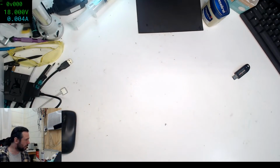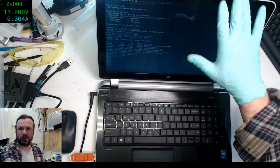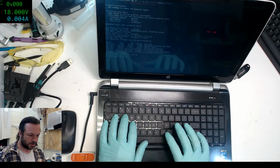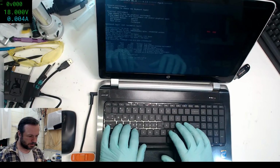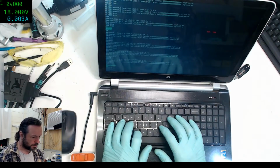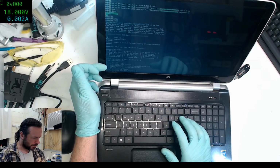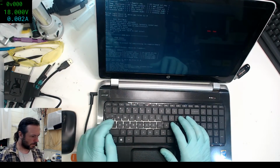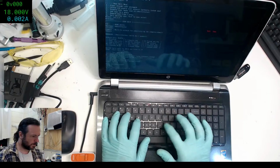We'll get back to this Windows machine. Okay, we've loaded up the Windows folder. We're going to go into Windows System32 config. Yuck, this is a terrible keyboard. We've got a SAM file, so chntpw SAM. We enable unlock 2. Okay, encrypt. Yes. cd, umount win. Reboot.